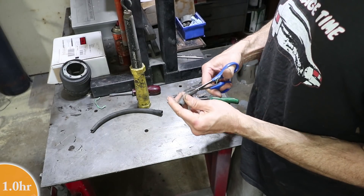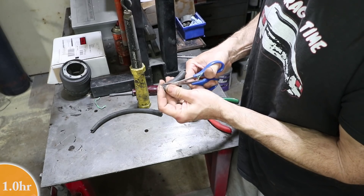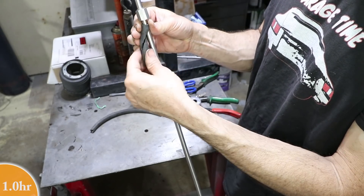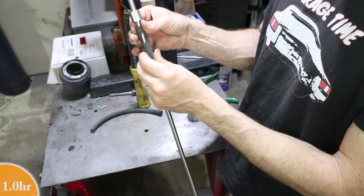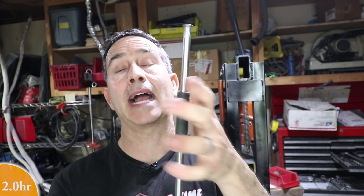This is the stainless fuel line — I made it myself. If you want to see that video, click the link right here. I've also cut some regular rubber fuel tubing and slid it so it is able to go over the stainless tubing. This is designed to protect the tubing inside the tunnel, where there are a few tight spots where it might rub or wear through. The stainless is pretty tough, but I still don't want it to rattle around.